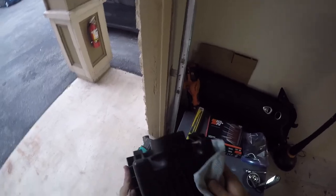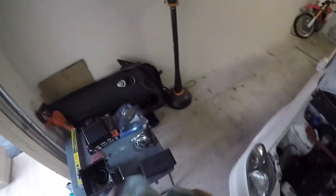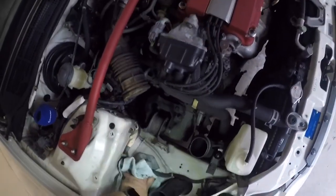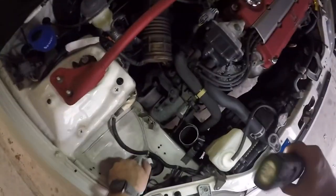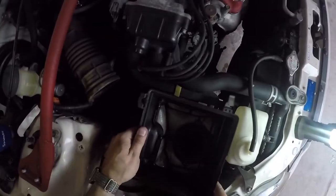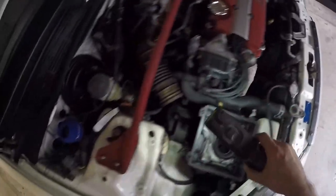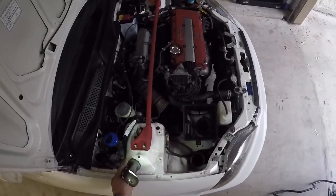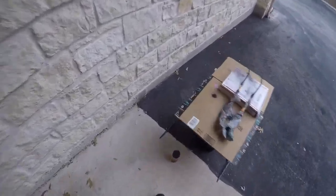When it comes to getting that lower portion of the air box out and back in, I used WD-40 to spray on that rubber pin right there. It has to connect to the tube on the bottom and then also slide into that pin at the same time, so it takes a little work going back and forth. I was also careful not to cut the radiator hose with the clip there. It just takes a little bit of angling to get it to fit in.